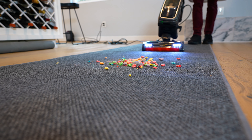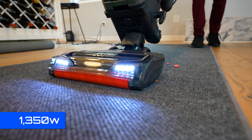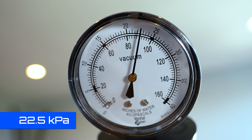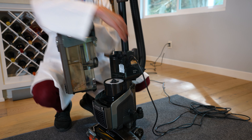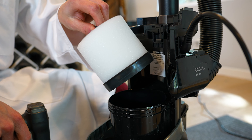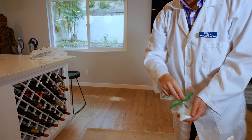But what you get in exchange is a powerful 1350-watt motor that creates a lot of suction and airflow. We measured it, and the suction was 22.5 kilopascals — a good number, right up there with the best of them. It has a fully sealed HEPA filter, which Shark says keeps the dust in the canister and out of your room. We tested this with a smoke machine and it worked really well — it kept all the smoke trapped within the canister.